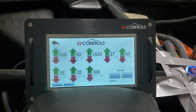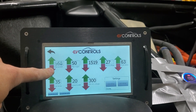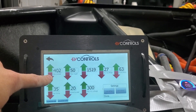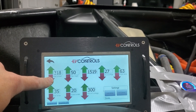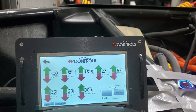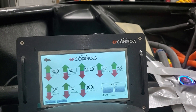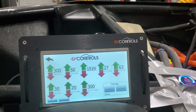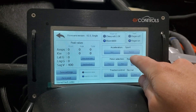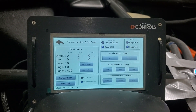I'm trying to set the controller parameters before the first drive. Max power is set to half of what it can do. Max regen goes from 99 down — I'm setting that to half as well. We'll see how things feel. The speed scaler we won't know until we start driving. Fan temp is fine at 35 Celsius. The accelerator G offset — we'll have to see about wheel spin. I've selected sport mode as opposed to maximum, rear motor, and traction control normal. Saving all these settings and getting ready to go.